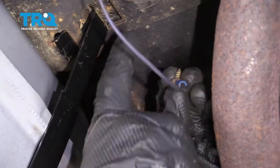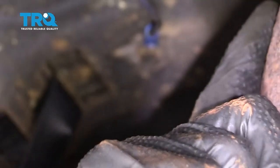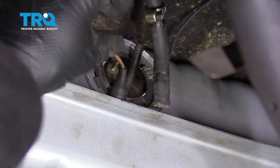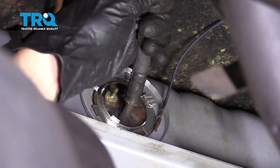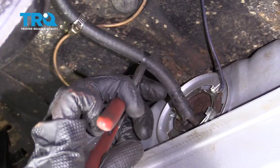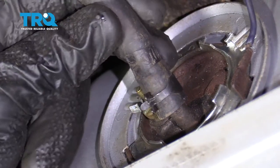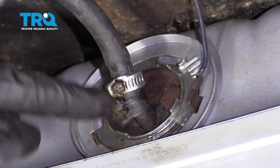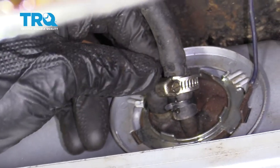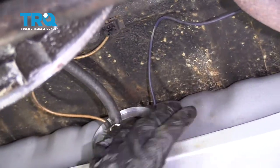Let's get the support out of here. Now we're going to put our pre-cleaned ground wire onto the body where we cleaned as well — make sure you have a good grounding surface and it's nice and snug. Make sure any wire you have isn't anywhere near your exhaust and isn't hanging down where it can get caught on anything. Let's reconnect our fuel hose — slide it right down. Put our clamp on here. Ours had two clamps so tighten that one up as well. That hose is nice and tight; there's no way it can slide off. Let's connect this wire now, give it a nice tug to make sure it's secure.